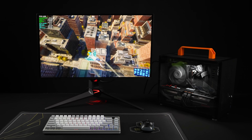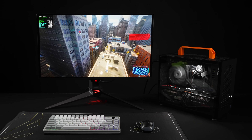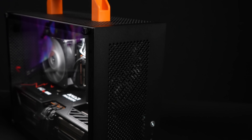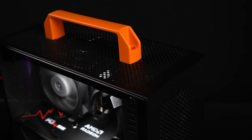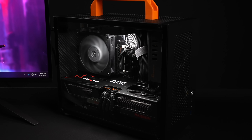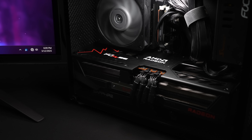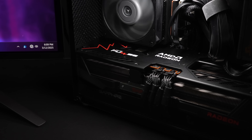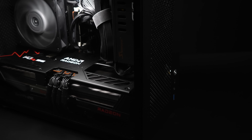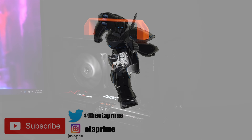Overall, I think the build turned out really nice. You could go with a much more expensive case, but I do like going with cheaper cases — it keeps the cost down. With the MinisForum all-in-one motherboard, that can also keep the cost down on a small form-factor build. If I had to change anything, I'd probably go with some different cables for the power supply and add a 120mm fan up front just to move a little more air inside the case. But other than that, I like the performance we're seeing here. Given the constraints with GPU size, I think this is kind of the sweet spot right now. If you're interested in putting something like this together, I'll leave links in the description for everything I used — and if there's anything else you want to see running on this rig, just let me know in the comments below.